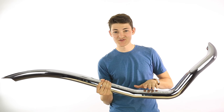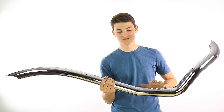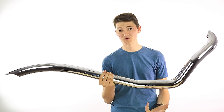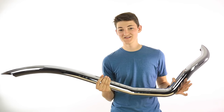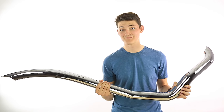You will probably need some servo eliminators for the air fuel sensors at the mid pipe, otherwise your dashboard is just going to light up like a Christmas tree. You may also have to take the center stand off your motorcycle, and passenger foot pegs could be affected. The installation is a little bit trickier but not impossible — it's really not worth basing your decision off that.